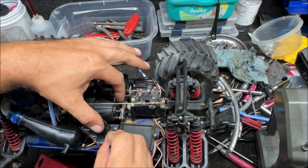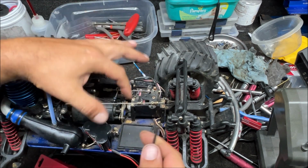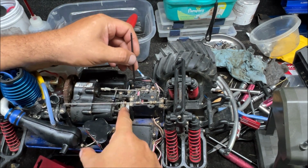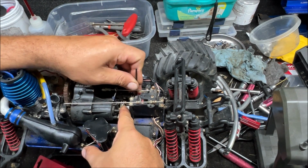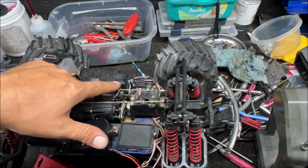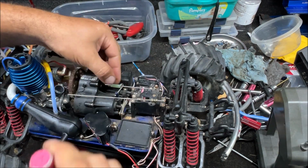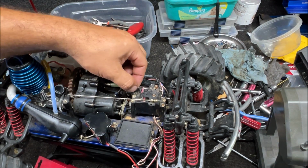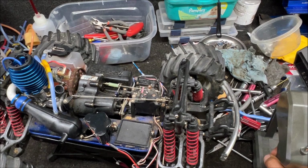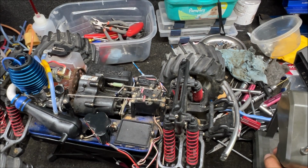This one's been bent. It needs to come off and straighten, but we can't do that right now. So let's just put your finger there, break off, screws even with the caliper. Okay, so see how we adjusted the brake and now it was moving over there like that. Now it's only moving over here like that. See that? We got a little bit of slack in there. That's all we need. All right, now we throttle, brake.